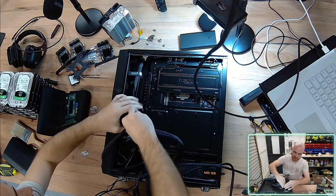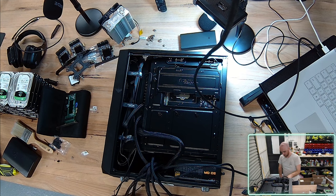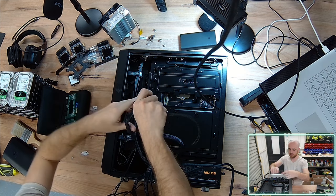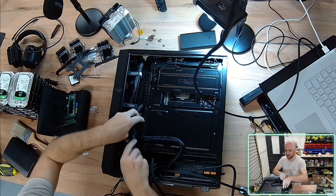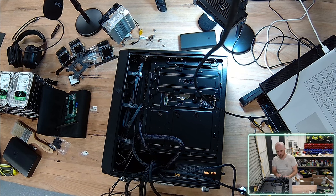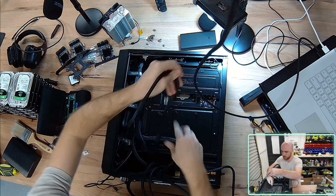Yeah, graphics card's also going to be around this point, so I'm just going to throw that cable through. Now, I have actually just installed what was on this power supply before, which is essentially GPU split cables. Ideally, I should have just installed the single versions because I'm going to have spare connectors sitting off the end of these GPU cables, but once again, this is not a pristine install, so I'm not going to get overly particular about this. I just want to get this up and running, functional.